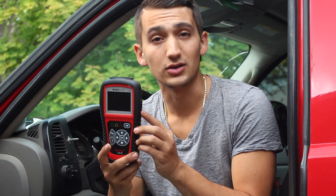Now it's not going to tell you 100% what the problem is, but it's going to give you an error. That error is essentially going to give you a clue as to where the problem in your car is. So say you have an oxygen sensor code — it comes up and you read it on your computer — this is not going to strictly say that you need to replace your oxygen sensor. You're only using this to give you a better idea as to where the issue is. So if it's an O2 sensor problem, you would go under the car, take a look at the O2 sensors, see if everything's working properly and see if anything needs to be fixed. Once it's fixed, that light should actually turn off on its own.